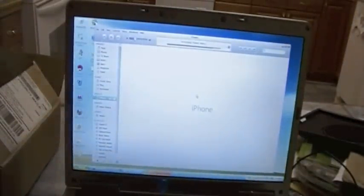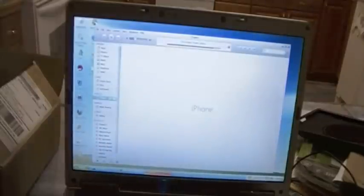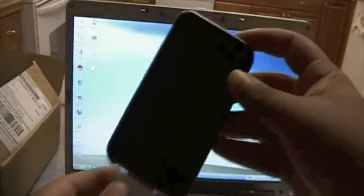There's my computer screen so you can see what happens on it, and I will put this into DFU mode. If iTunes comes up, you can go ahead and close it out — you don't really need it up yet. Let's put this thing into DFU mode. Holding down both buttons for 10 seconds, then letting go of the power button and holding down the home. Here we go.